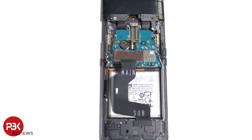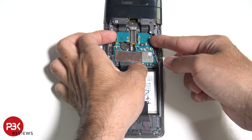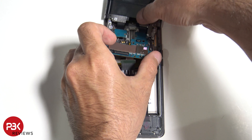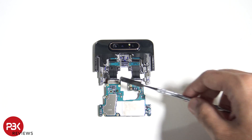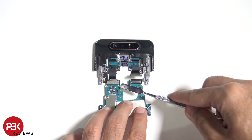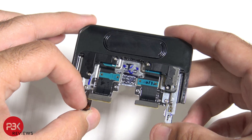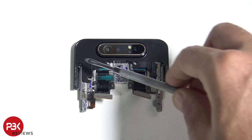You have five Phillips screws holding down the main board. Here's the back side of the main board. We're going to disconnect these two cables coming from the camera assembly which are attached to the main board. Here are the levers that rotate the cameras. Now you have to pry off the top panel over here covering the camera assembly.